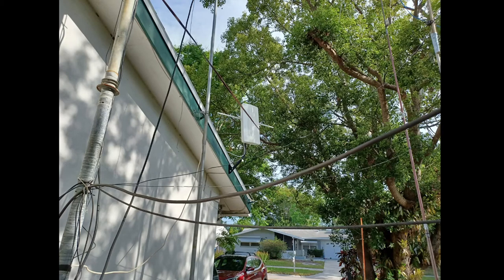They supplied me also with this pole here, this J-pole, to mount it. And this direction is east, where the antenna farm, I'll call it, of the OTA transmitters is southeast, which is where this is pointing. Now, when I was out there, the things I discovered is all these trees in my yard. Like this big tree here probably prevented me from receiving that one station that's north of me. And this is a tall tree, it's over 40 feet tall.